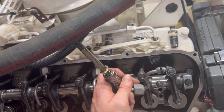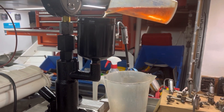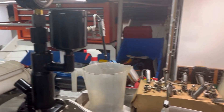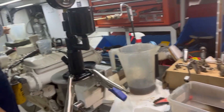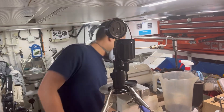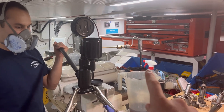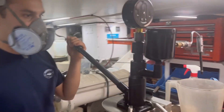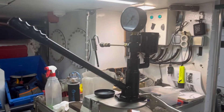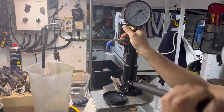With all injectors pulled, the next step is injection pressure testing. We set up a little jig on our vice with this tester, filled it with fuel, and got the injector plugged in. You pump it through a few tests: a bleed valve leak test, a flush, and a pressure test. We did all of those — we'll show you the results.